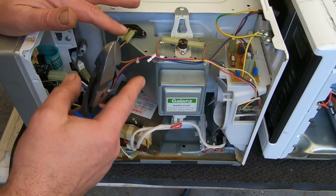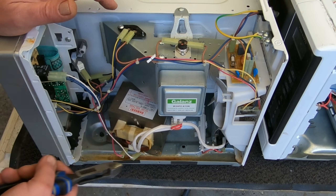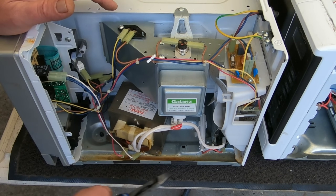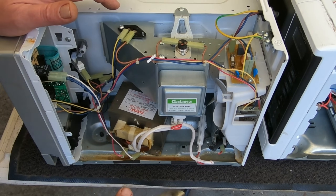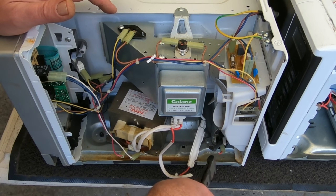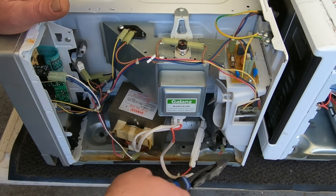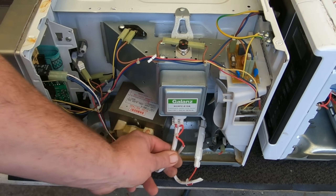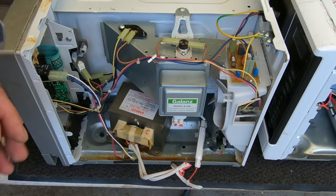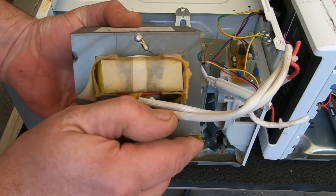The other thing I didn't mention is that regular microwaves with a transformer will have a large capacitor, whereas inverter microwaves don't really have one of these big capacitors — it might just be a small one on the circuit board. As a safety precaution, I just cut the capacitor wires. If there's any charge left in that capacitor, we don't have to touch it anymore. I don't remove them — there's no point. Same with the magnetron — I just cut the wires, snip a few wires off the transformer, and there we go — a nice transformer.